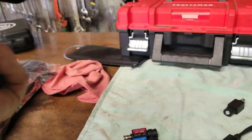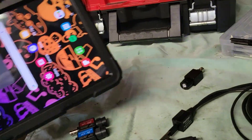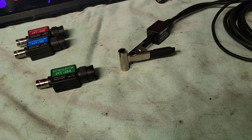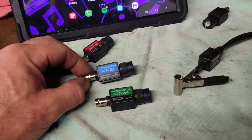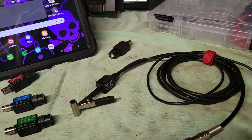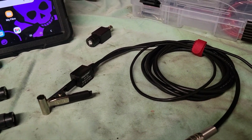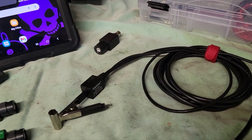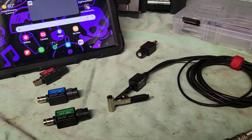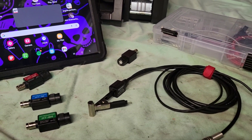I like taking this tablet instead of a laptop around. You could get a cheap case on Amazon and an Android tablet anywhere — some are better than others, but it's working pretty good. That was the first issue I had, so enjoy the video. I have a Toyota coming in and I have to put a timing chain on it. It has coil-on-plugs, and whenever I diagnosed the timing chain I also noticed that one coil was still firing but a little bit weak. I'm going to use the Hantek paddle probe and see if it can isolate the one that's weaker than the other three.